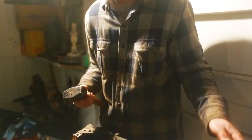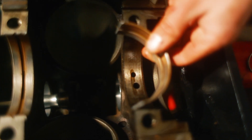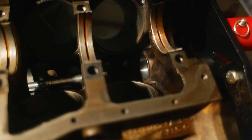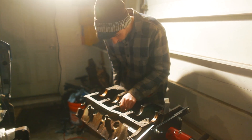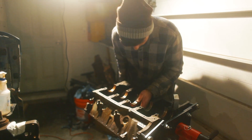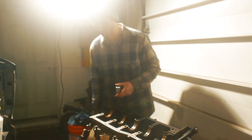This one pushed in all the way — we're flush with the block now. And if you look through the oil hole, it lines up with the slot, so this bearing is good. We don't have to do anything further with that rubber bushing to try and get it in the last couple millimeters. We'll check all of them to make sure. This one here needs to go a little further, but otherwise we're almost done and ready to install more fun stuff.